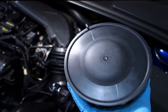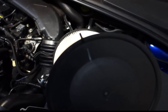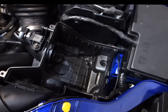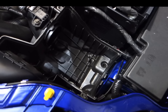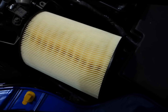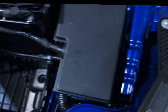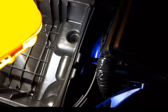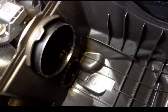To remove the filter, start lifting from here. There's a rubber grommet that connects to the air tube, which is usually a very tight fit. To pop it up, lift from here — it's much easier with both hands. Here is the air filter — it looks huge, it's a radial type. You see there's a notch over there. This is a genuine Ford air filter; I'm not sure if aftermarket filters have a notch, but there's a slot on the housing that corresponds to it.